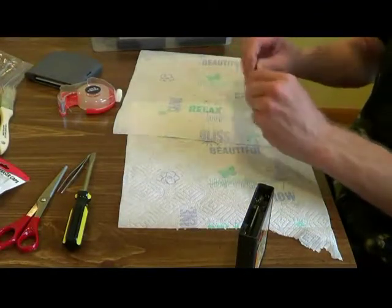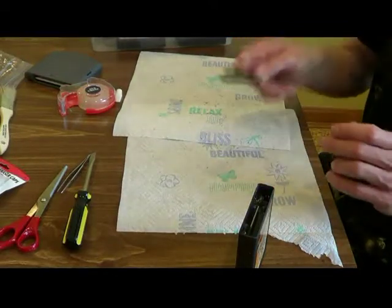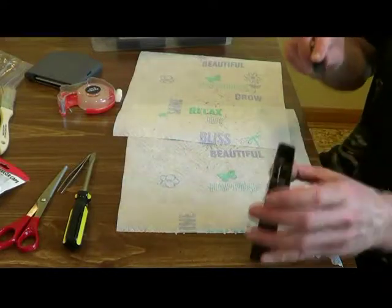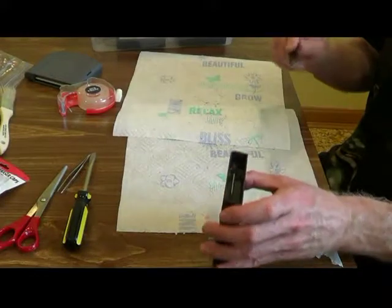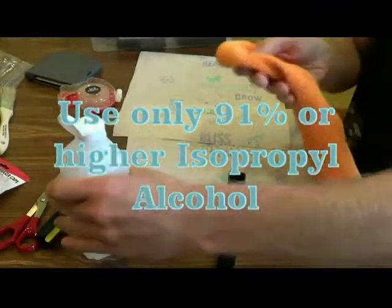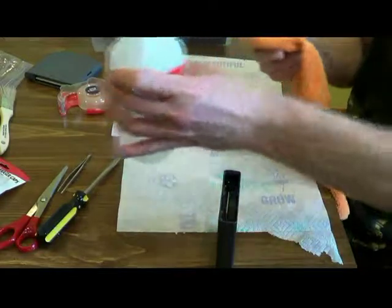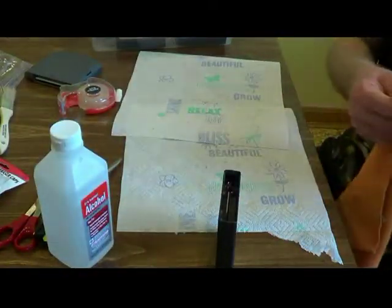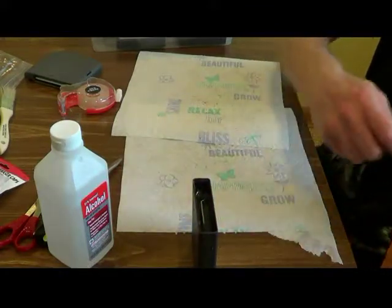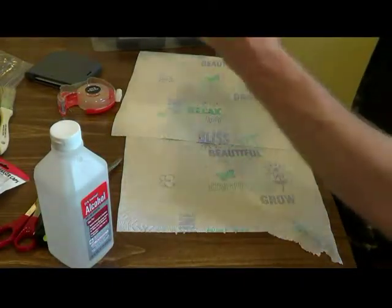Take the same tool. Like I said, it doesn't have to be the Nintendo. As long as it's plastic, you want plastic or wooden, no metal, or you will start gouging and tearing up and doing some major damage to the contacts on this. Take a microfiber cloth. What I'll do is dab a little bit onto the microfiber. And like I said, the reason why I do this is I want to get any little particles out of there since I'm not taking this apart. I guess I'm a little bit ADD about this, but if you don't do this, it's a big deal. I like to just get in there and wipe.